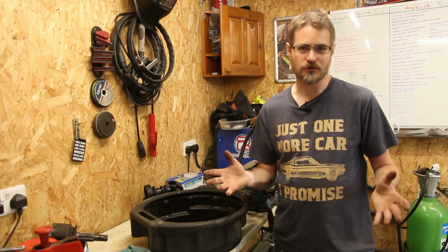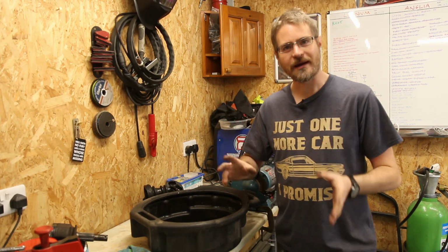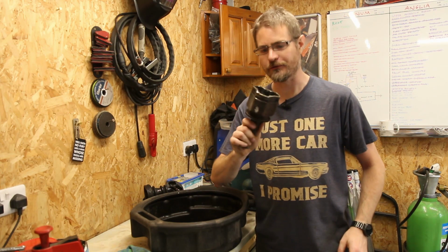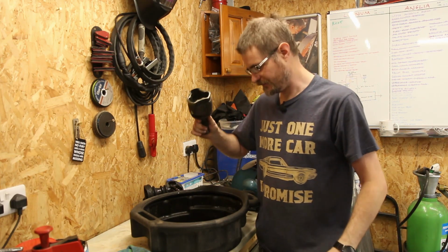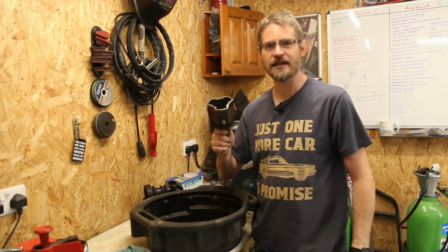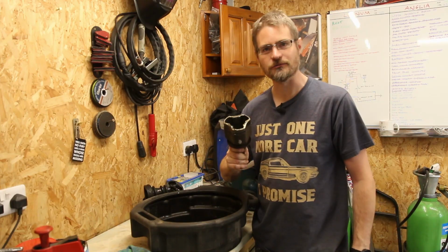So that's the drive shafts all now made up, and because I'm going to the effort of remaking them nice and straight, when putting them back together, I thought I would give them a damn good clean up, get rid of all of the old grease, and put in some new stuff. So I will spend the next few minutes giving these a very thorough cleaning out with probably brake cleaner, because it's fantastic stuff, and then we can look at reassembling the drive shafts and getting them reinstalled.